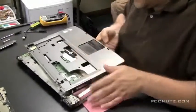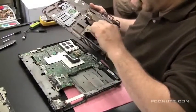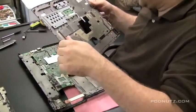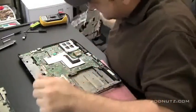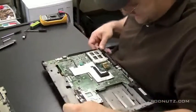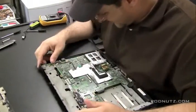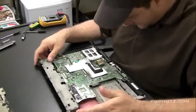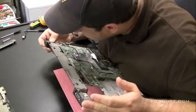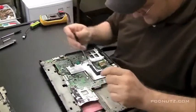Just taking my finger now and pressing it in between the two covers to pry off the front. I'm checking the computer for corrosion. It looks like something did spill in there — there's discoloration on the top cover. Always look under that sticky black plastic if you can get it off to see if there's any water, moisture, or white spots of corrosion. I'm looking at the power jack there, just trying to determine what the problem is — if the motherboard is fried or if it's just a power jack problem.